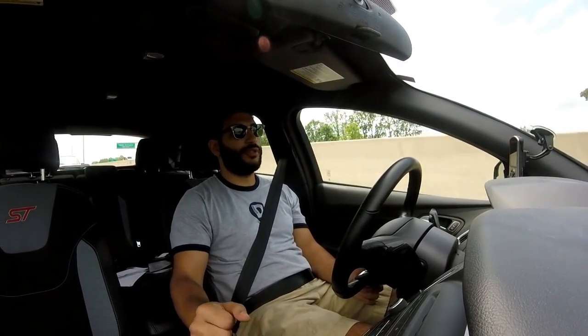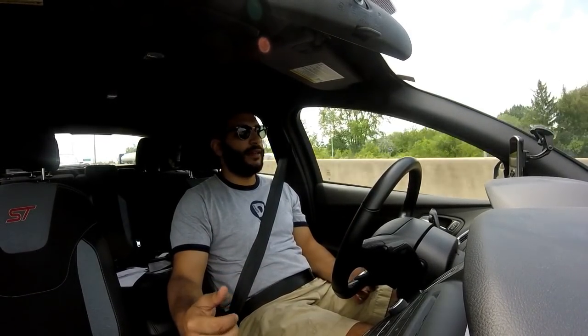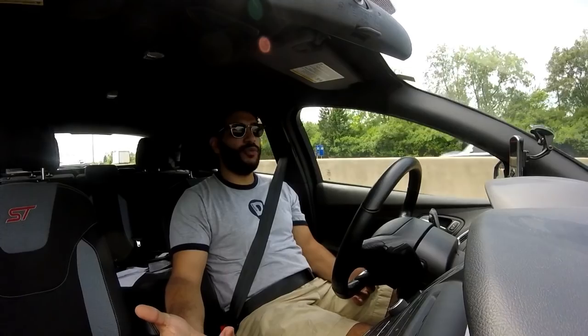Today's video is about one of those big baller, hardcore parts, the big brake kit. So when choosing a big brake kit, I feel that there are three things that have to be considered. The effectiveness of the kit that you're buying. Just because it's bigger, has more pistons, doesn't necessarily mean that it outperforms your stock system.